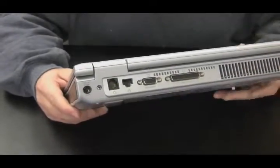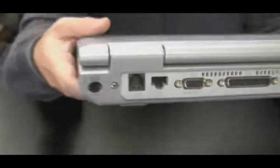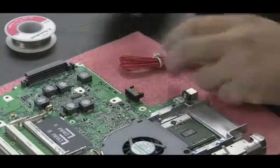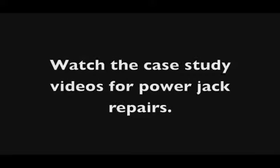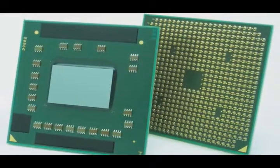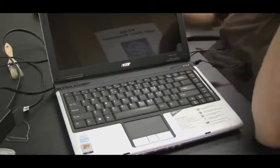Another reason a motherboard might not turn on is if it's not getting power to the power jack — the power jack might be damaged. Observe from the outside to see if the power jack is loose or detached from the motherboard. If it looks secure, the only way to test it is to get down to motherboard level and look at where the power jack is soldered. Also, a bad processor could be the cause, though that's fairly rare — about one in 75 computers. A broken power button is another possibility but also unlikely.